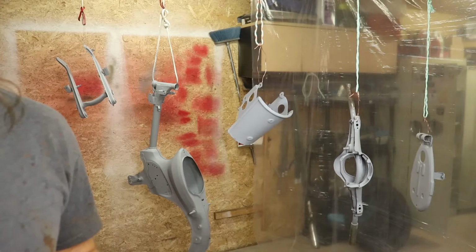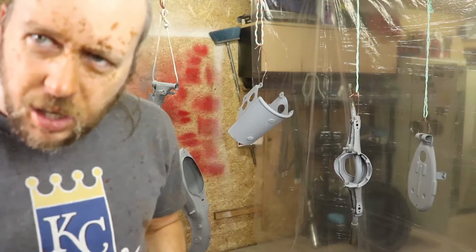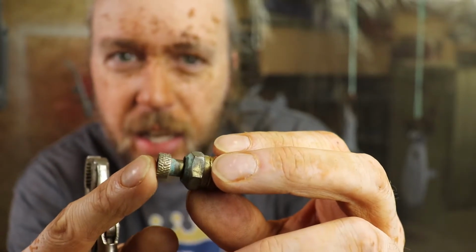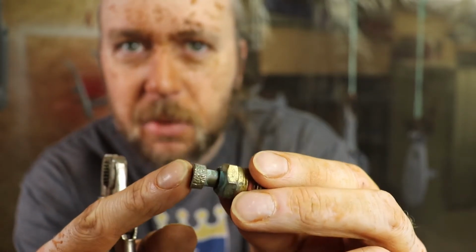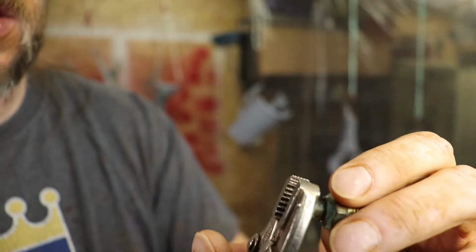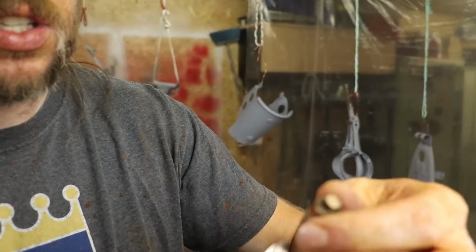So I just went to let any excess water that's in the bottom of my compressor out, and when I did, the middle part here got blasted out and all the air started rushing out of my compressor, and I also got a face shot of rusty water. So that sucks. It appears that this is not going to seal anymore. I've got this turned all the way in. I think it actually blasted the rubber O-ring to bits. I can see there was a tear in it.